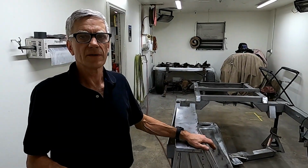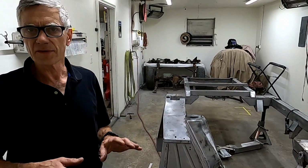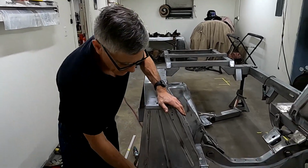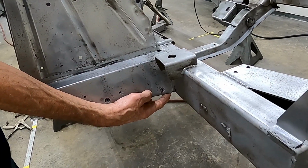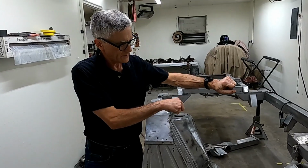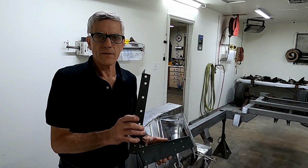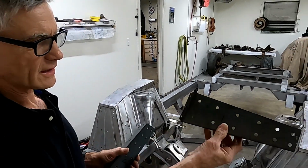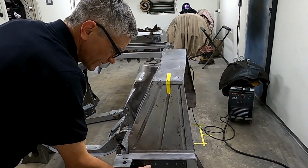Before you do any repairs to the frame, any welds that need to be reinforced or added or broken spot welds, you have to fix the missing weld right under the bottom here of the front tower connection. And when you're doing that, you have to spread the towers out to the correct dimension. When we do the weld repair on the missing weld, we also add a reinforcement piece that fits right down here.